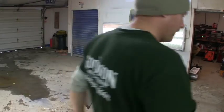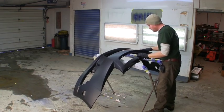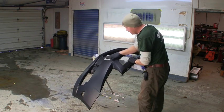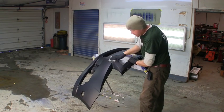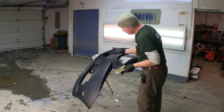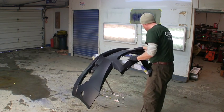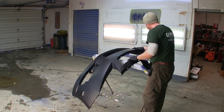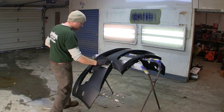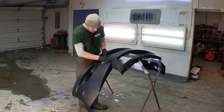I'm going to use these pads to scuff with. I normally use a sanding sponge but I'm going to try these because the paper cuts so nice. I'm thinking I'm going to like using these better than scuffy gel and that sort of thing. These bumper covers say you can scuff them with 800 grit and go. You can see it's already dusting up that primer real good. They don't put a lot of primer on these covers so you don't want to get aggressive with sandpaper like this, otherwise you'll burn through it.